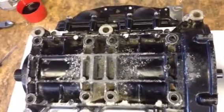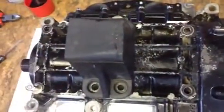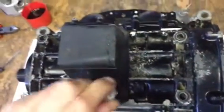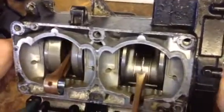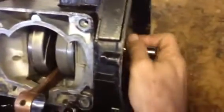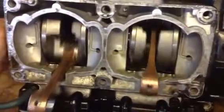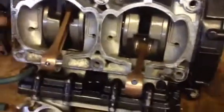So now the seal goes on — or the rubber which the motor is mounted on — and the bolts go in. So the eight bolts are in, and after checking that the engine's rotation is fine, double checking that your pins are in position and that you haven't cracked your bearings, you can start putting on the pistons to the con rods.